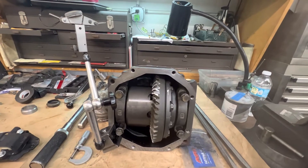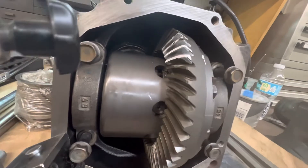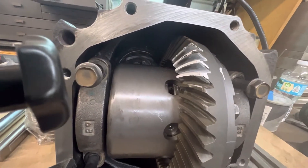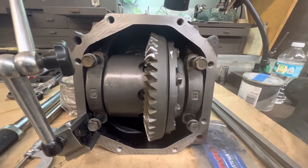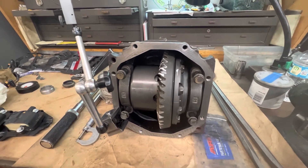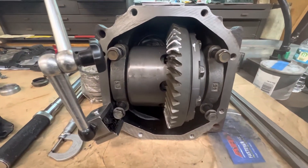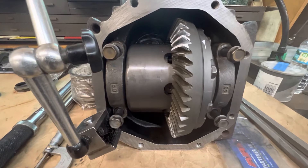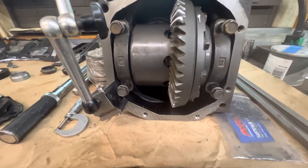We're at the end of the second day on this. We have our setup now and got a beautiful pattern. Backlash is still a little bit wide, so we're going to get into some custom grinding on shims tomorrow so I can finish this off. Pinion depth is right on the money. I just need to get maybe another two or three thousandths out of the backlash, I think. But tomorrow's another day.